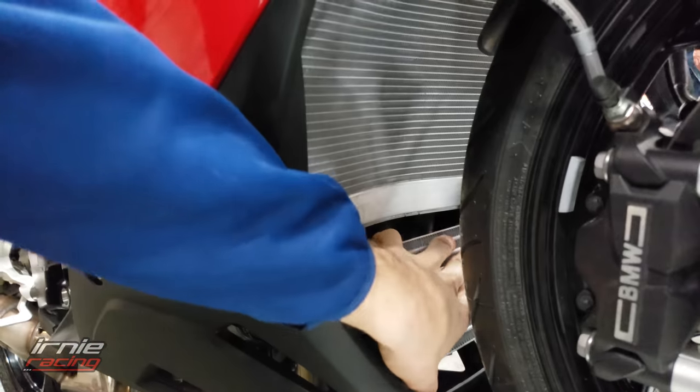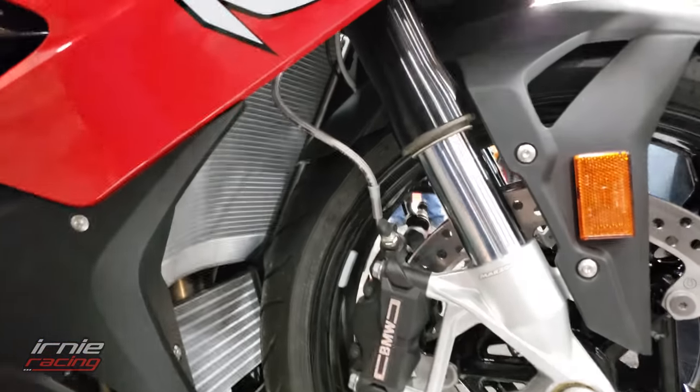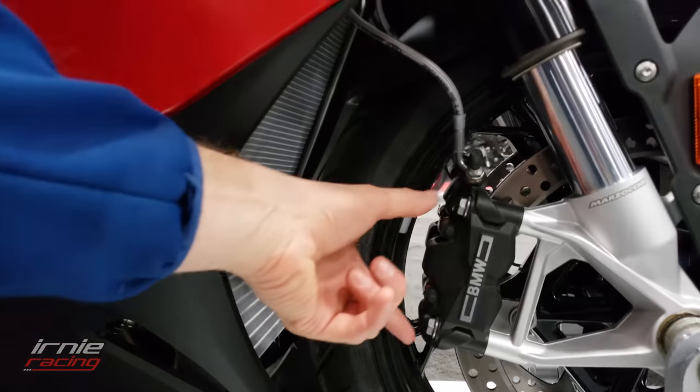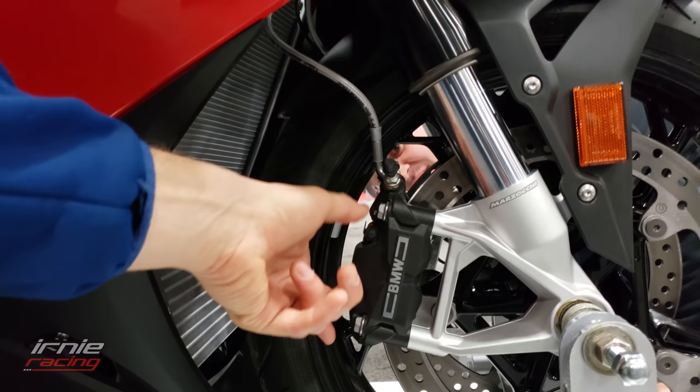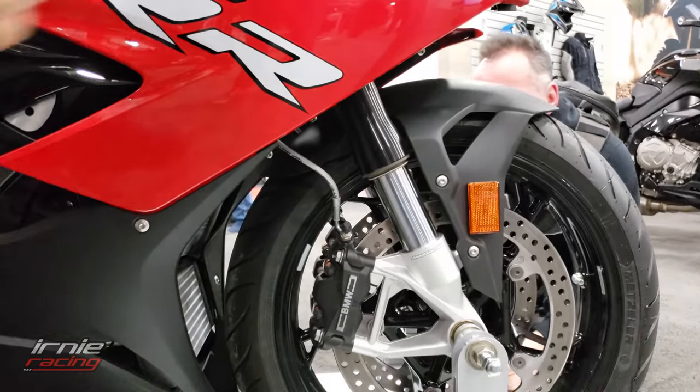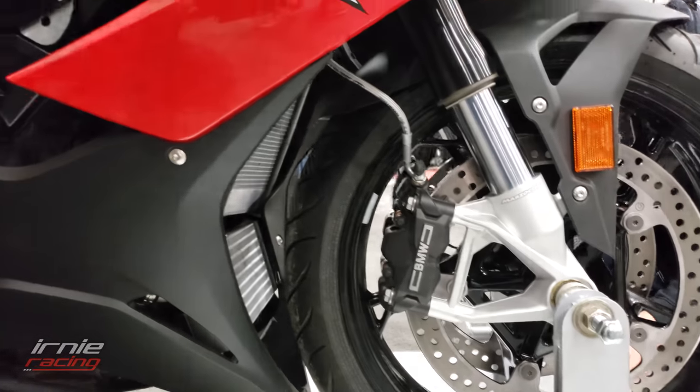The front fenders might fit. It's different, but yeah, the bolt might fit. Are the forks different? Well, they are quite a bit different, actually. We need the speed sensor. We should have brought a measuring tape. ABS sensor. We need to see if it's 100 millimeters for the calipers, between the two bolts.